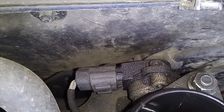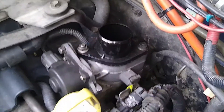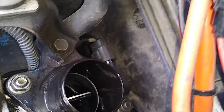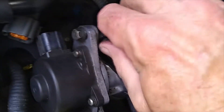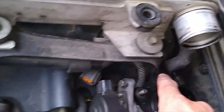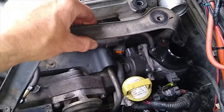Pull the plug out and disconnect it. There's another plug over the back for the throttle position sensor — undo those two bolts. You need to release the connector on the side for the engine wiring harness and all this will lift straight off. There's a little release button on the side — push that in and pull the plug off the stepper motor. Then pull the plug off the back of the throttle position sensor and undo those nuts. You also need to remove the bracket that holds the intercooler — pop out those two bolts plus one up the front and take the bracket off, which will allow this to lift out.